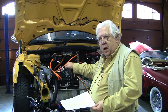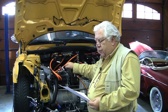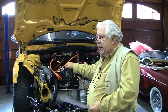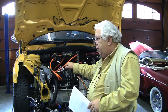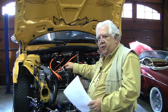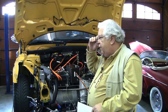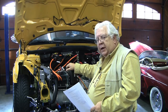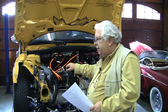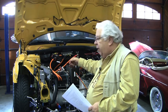You're going to have to spend some time on any controller you get — DC or AC — going through the control signals and software settings available. We recently received a controller from someone who wanted us to put it on TV. I asked a couple of questions about programming throttle levels and he assured me that if I sent it back they could do that for me. That dog doesn't hunt. These cars are too variable — we change things all the time and you need to be able to change them to set the feel of the car. It takes quite a bit of testing once you have the car rolling to get it to feel right.